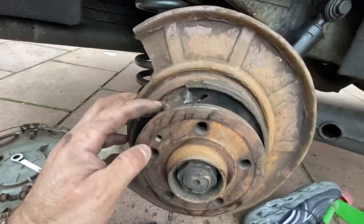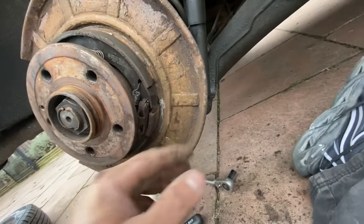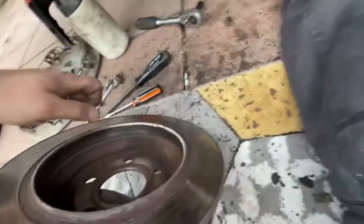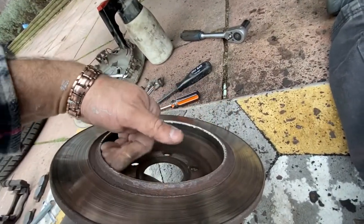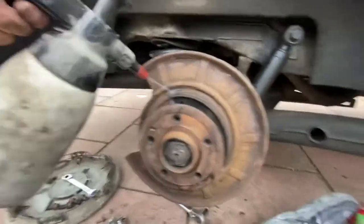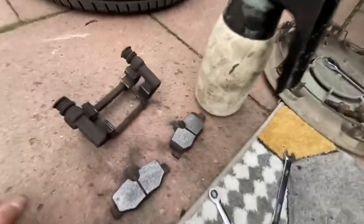I think I found the problem - it just needed tightening. When the piston pushes out, it pivots on that, which makes the shoes go out onto the inside of the drum. I've given it a little clean and used the grinder on a tiny lip - there's no lip now. I'm hoping that was what was catching. I've also given it a wire brush, and you can still see little particles of dust, so I'll use brake cleaner. These can go straight onto brake pads and discs, no problem. Just let that dry.